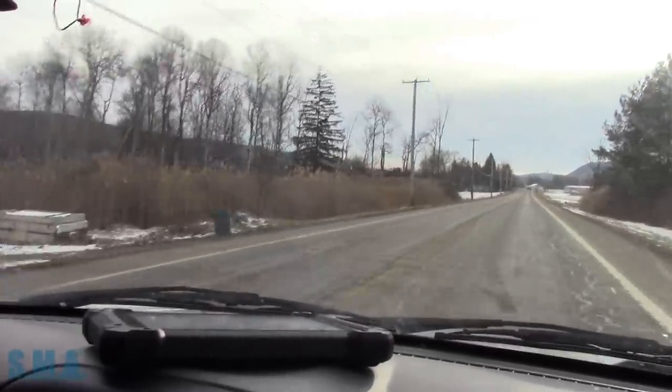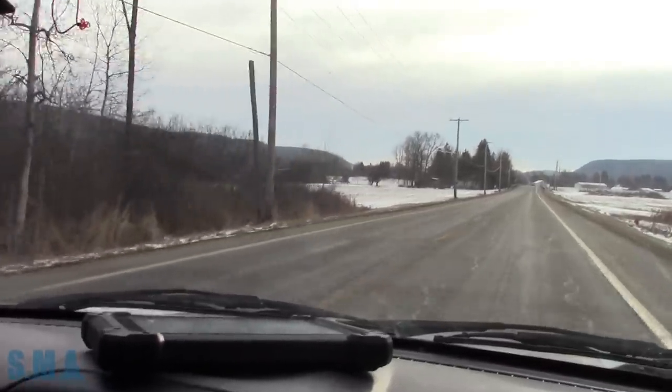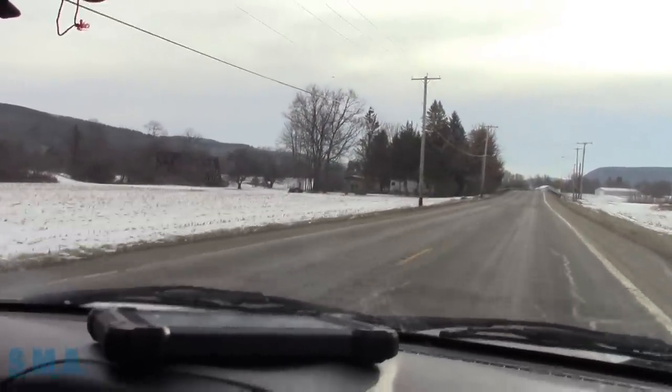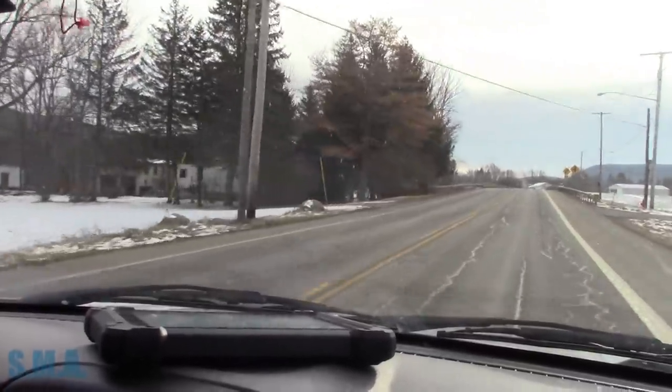So I usually just ask my customer, where do you live and where do you go to work? And if it's a 20-minute commute every day, I tell them, drive it to work 3 times, come back and see me, I'll see where it's at. 90% of the time, the drive cycle is done at that point.